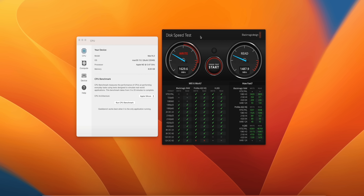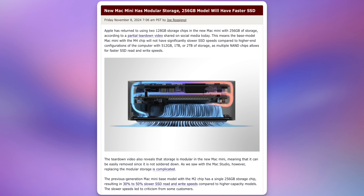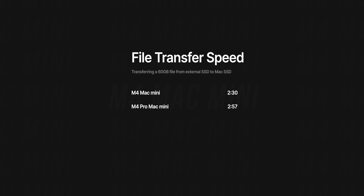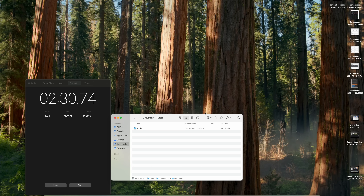Here's where things got interesting regarding the SSD. With the M2 Mac Mini the 256GB model was very slow, but with the M4, Apple is back to using two 128GB chips to make up 256GB of storage, eliminating that bottleneck. I tested file transfers multiple times — transferring 60GB of audio files (103 files) was less than a 30-second difference between the two: 2 minutes 30 seconds on the M4 versus 2 minutes 57 seconds on the M4 Pro.